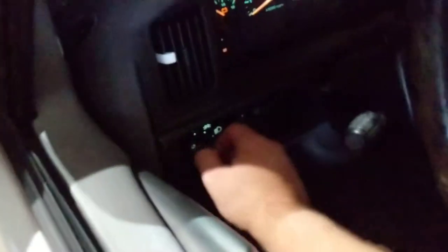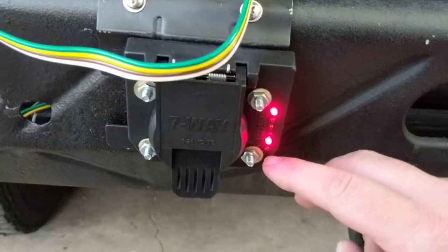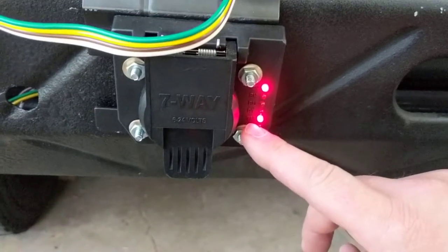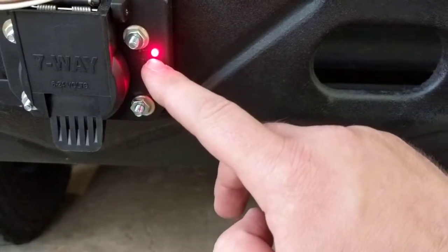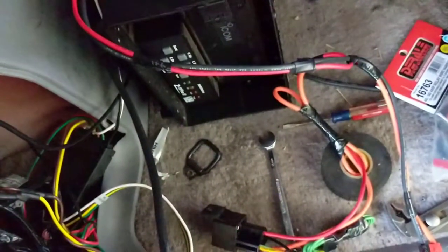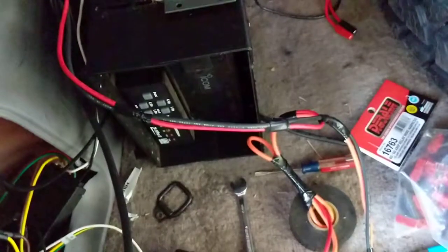Let's turn on the vehicle lights — actually the marker lights would probably work. Yes, they do. So when we drive with the marker lights on, you can see down here the connector with the LED indicator. This one says TM — M is for marker — so that's the trailer marker light. And up here this is the 12-volt feed. When we turn the vehicle lights off, it disengages the relay, so no juice back here. I don't have to remember to come back and unplug something or worry about draining the battery.